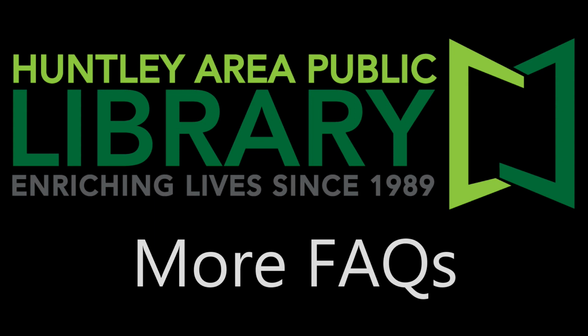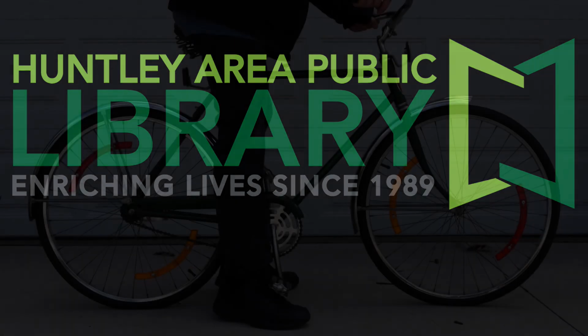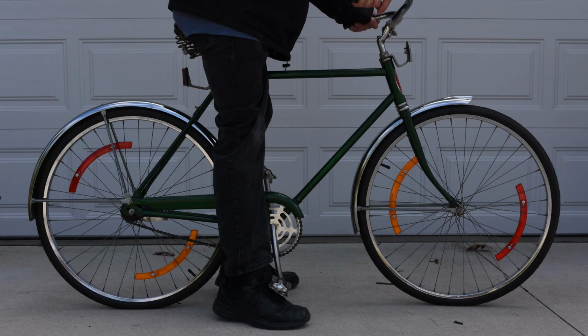If you're just going to use a bike for one season, then that's not so much of a concern. But a basic rule of thumb is the top bar of the bicycle, the bar that you need to throw your leg over, can be no more than the inseam of your pants. So if you wear a 32-inch length in Levi's, make sure that top bar is below that. And also, for some people, that may be difficult to throw your leg over something that high.